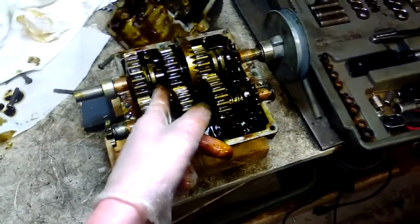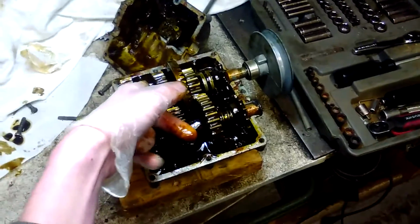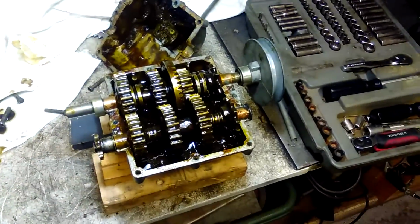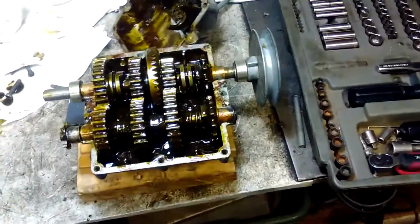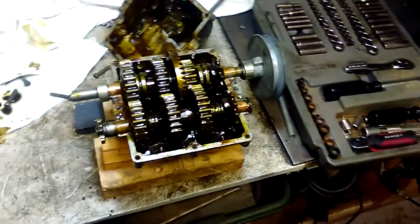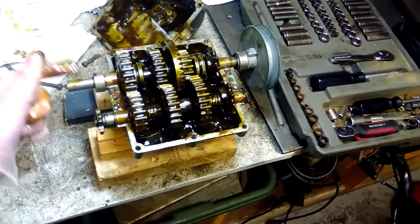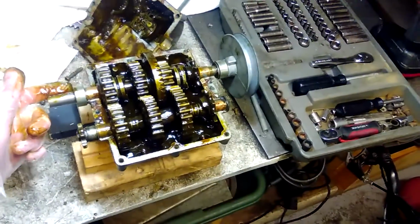I can make these on a mill or something, and then make that slot in a lathe. I don't even know, I wouldn't even need a mill. I would need a lathe to make that slot though. I could make the rest with a freaking angle grinder if I wanted to. But yeah, that's what I did. It's just a piece of 5/8 keyed shaft.